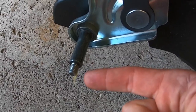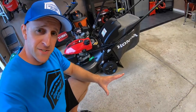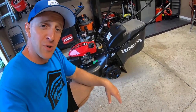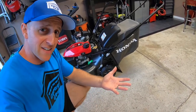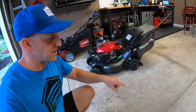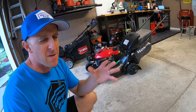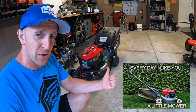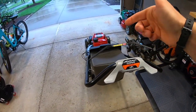After all, Honda put a little dab of grease on each of the wheels anyways. I don't think Honda would have done that if they didn't find some level of importance in it. Some people have also told me that a lot of clippings will get stuck to the gears inside those back wheels, but if you have good dust covers on the back side of those wheels, you really should only have a minimal amount inside by the end of the season — really not something I worry about, and I clean it out yearly anyway. Now if your lawnmower has wheel bearings on the front and back wheels, you may want to consider taking out those bearings and repacking them full of grease maybe every couple of seasons. This is one of those procedures that takes 5 to 10 minutes to do, and your gears will thank you down the road. The mower is a lot easier to push now, and I know plenty of small engine mechanics that do this year after year.